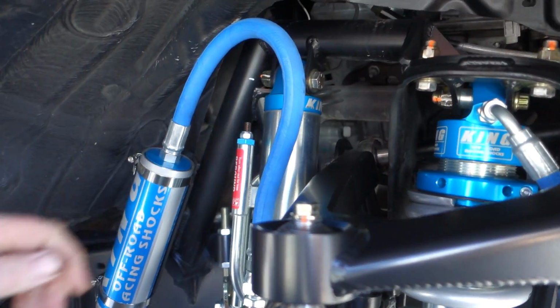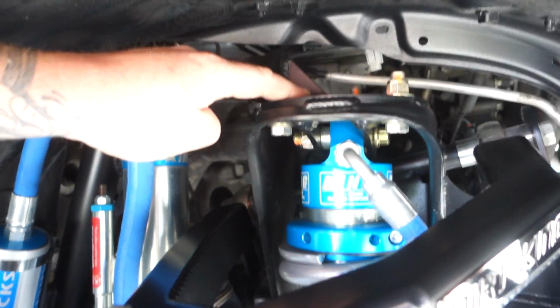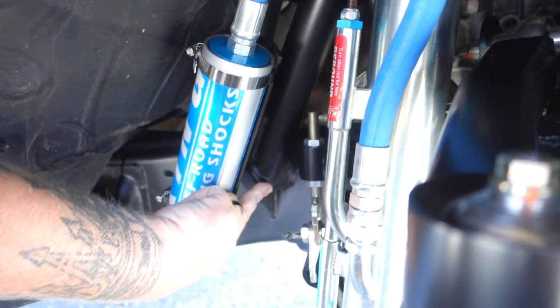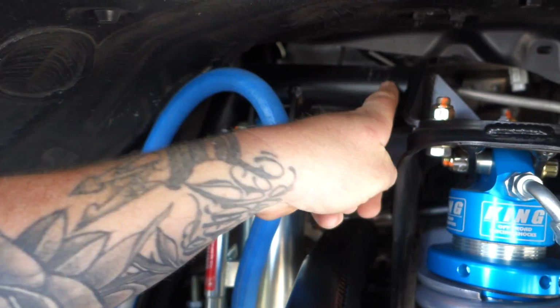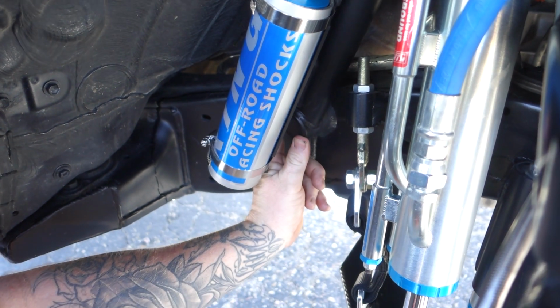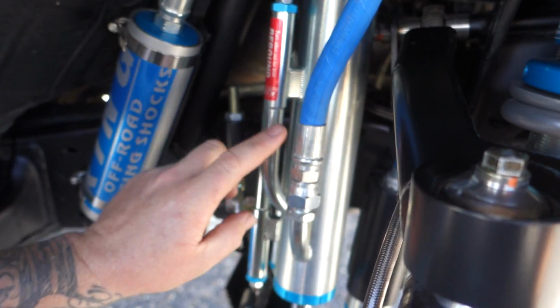This is their bolt-in bypass hoop as well. That locates off the factory coil bucket on the top. It comes with the mount to weld onto the frame and then a reinforcement tube that goes behind the bypass right here. This top part is factory and bolts on, and this is all one piece when you buy it. Then it comes with this tube that you weld onto the frame. It locates really easy, and then that mounts to their spec bypass.